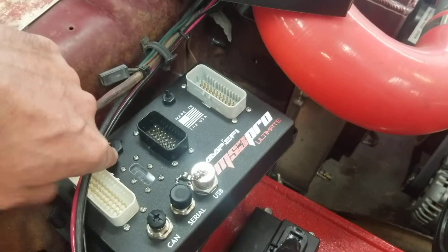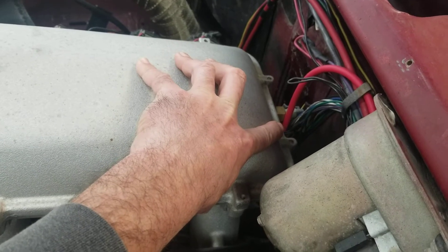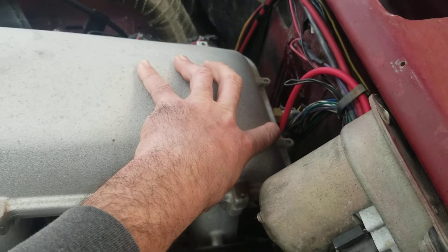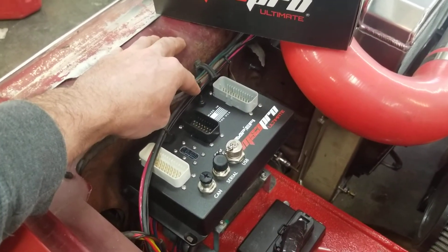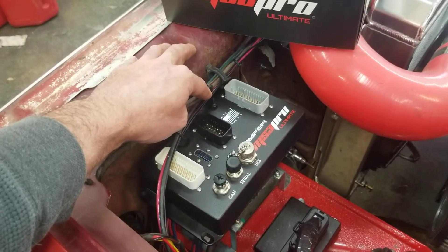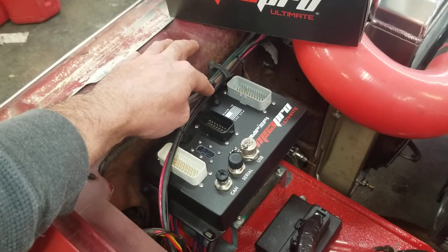Here you have your built-in four-bar MAP, and here's your built-in barometer, so you don't have to run an external MAP like on the back of this one. It's got a built-in MAP sensor — I think it's a two-and-a-half bar off the blower Corvette — so that'll be built in. That means I can get rid of my external boost controller, which is an AEM True Boost. Those work, but this one has honestly gone bad once and it's less than a year old.